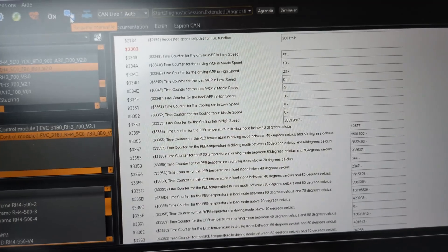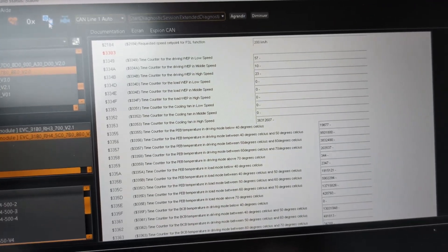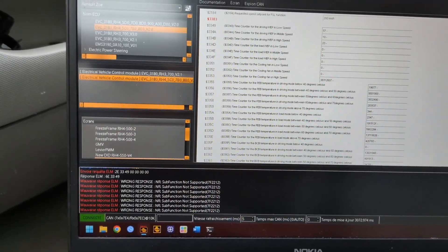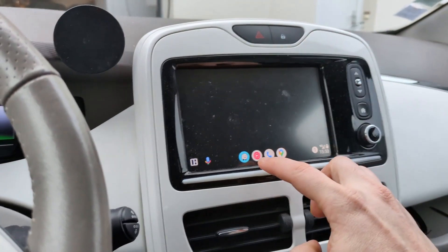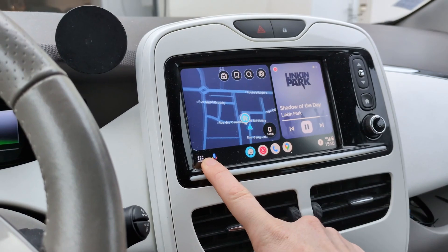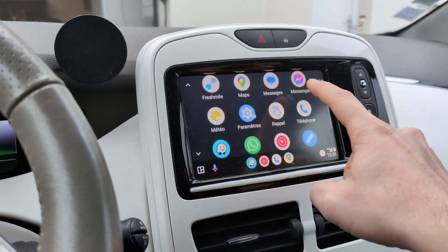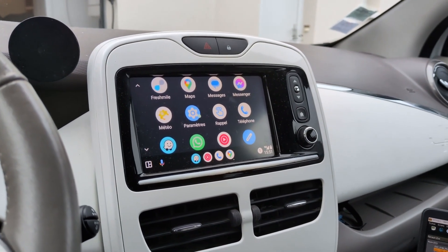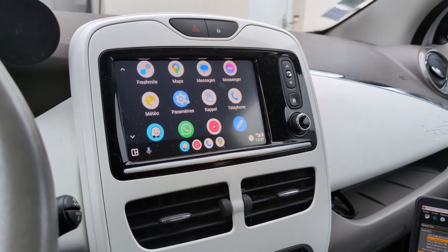After that, your 'Check Electric System' light on the dashboard should be off. If that's not the case, use your OBD fault reader to reset the fault code and everything should go back to normal. Don't worry about any communication fault — it doesn't affect the tutorial. By the way, with this same software I also enabled Android Auto on my car, giving me access to Google Maps, Waze, YouTube Music, and more — even wirelessly with a dongle, just like a newer car. I'll show you that in the next tutorial. I hope you enjoyed — leave a comment or question and I will answer.